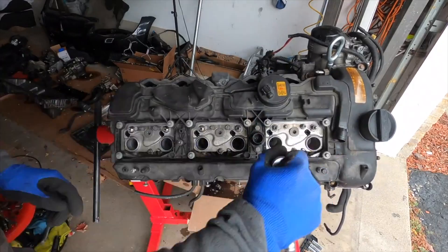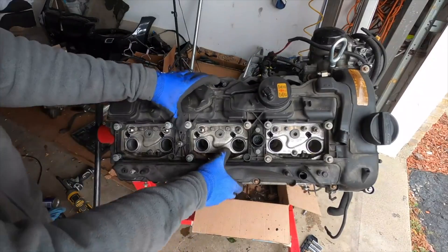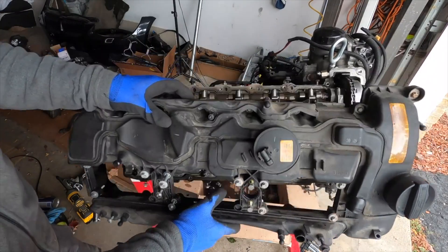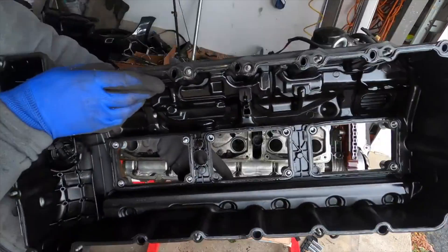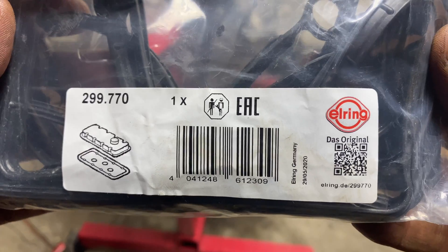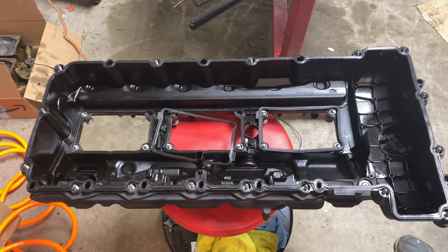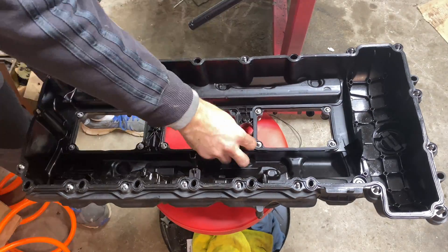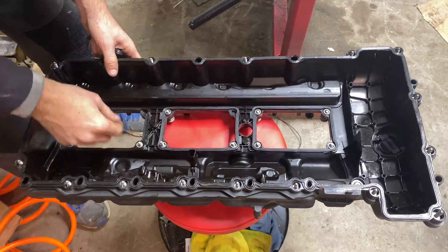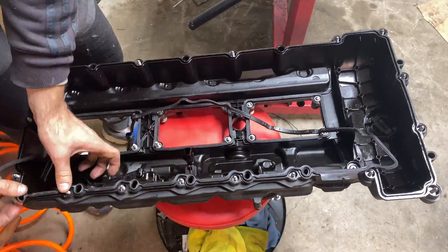If you're reusing the cover, make sure to unbolt all 26 bolts in the correct sequence and remember that these bolts are attached to the cover itself and will not come out past the plastic part, so don't force it. With the valve cover removed, we can inspect the surfaces on the cylinder head, remove any bigger debris with a plastic razor, and use scotch bright pads for anything remaining. The valve cover itself has four different gaskets that should be replaced each time the cover is removed to avoid oil leaks. Replacing them is very easy — remove the old ones, clean out the channels, insert new gaskets, and you're ready to go back on the cylinder head.